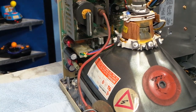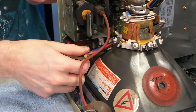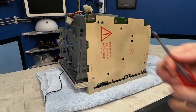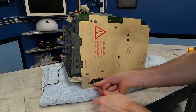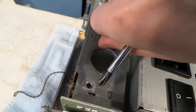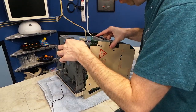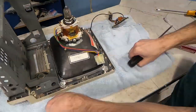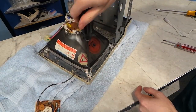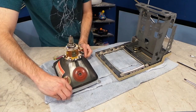These wires control the magnets on the tube and they need to be unplugged. Next, remove the analog board — there are two screws up top and two more down below, plus one for the ground wire, then carefully lift the board out. There are four large screws holding the CRT to the machine; remove those with the Torx driver and you can lift the tube right out.